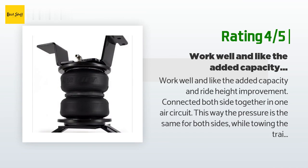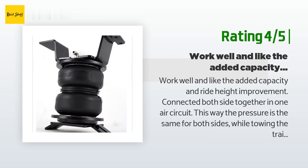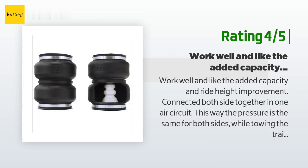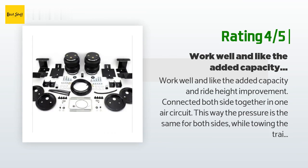T21838. Mounted my air fill in the rear bumper under the spare tire lock, there is a plastic filler panel there and it is easy to drill a hole. Be sure that it is low enough not to interfere with the spare tire lock in a 2015-2017 Silverado. Also ran lines through the frame using existing frame holes from the axle back to the bumper. Very clean install. I have Airlift air bags in the rear springs on another."